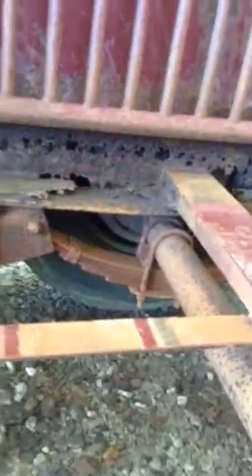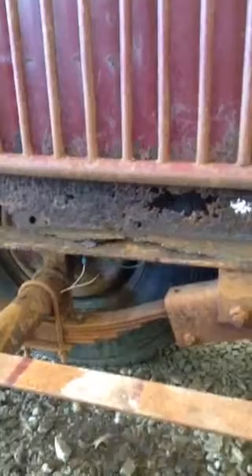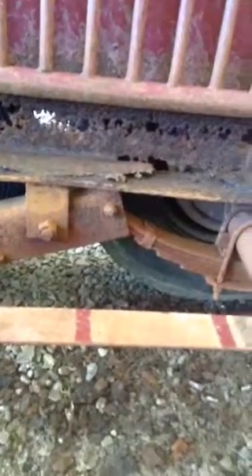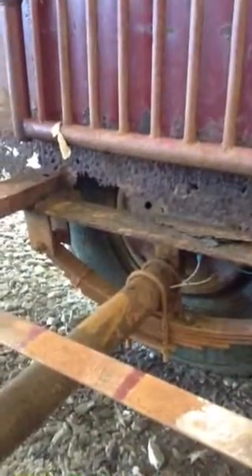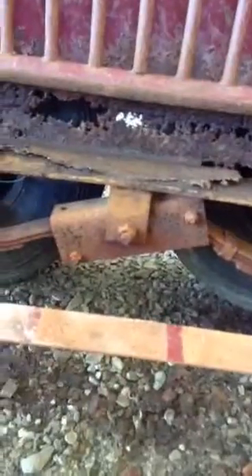Let me let you look at this one more time. I managed to get the air chisel up underneath and get out a lot of trash that was flaked loose underneath, and that's why you've got that big gap you can see right there. My thinking is to cut the rest of that out and put maybe flat bar or angle iron on top of the piece that already runs across there, because the leaf springs are welded onto that piece.